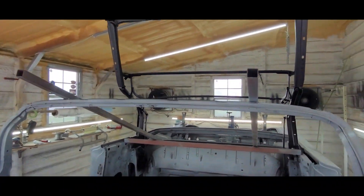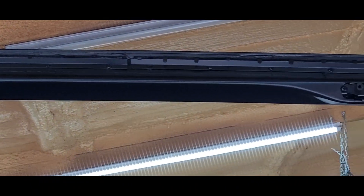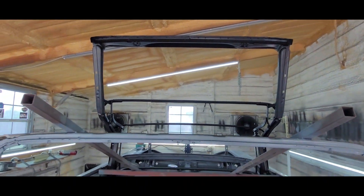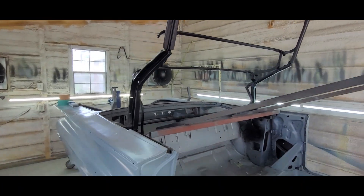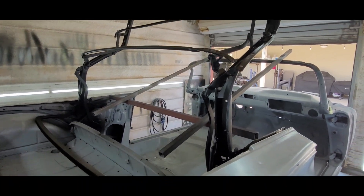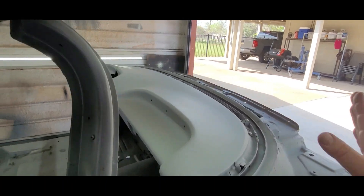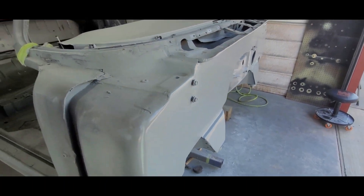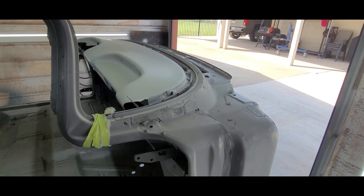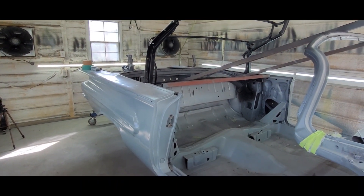So that's going to be it for the top rack. Overall it wasn't a very hard project, just a little tedious. I'm going to let this dry probably until Sunday, then mask it up real good, put it down, and it's going to stay down until the car is painted. Moving forward I'm going to go ahead and sand this dash and get it in epoxy to match the firewall. Then the dash, firewall, and cowl will be locked down ready for paint, the top will be done, and I'm moving on to the rockers. Hope you guys enjoyed this little update — thanks for watching, stay tuned for more work.